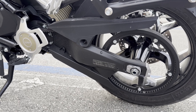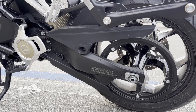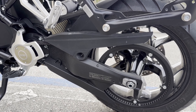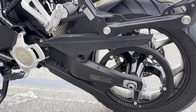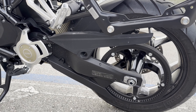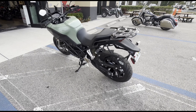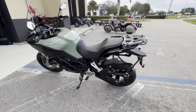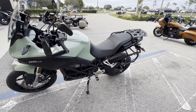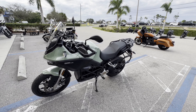My one major issue with this bike is the belt drive. Belt drives are bad enough on a low-horsepower Harley, let alone a high-horsepower, high-torque electric motor — especially for a bike built to go off-road. This is rated for moderate light ADV, but there is a chain drive and sprocket conversion for this bike which would make it much more suitable for the style of riding I like doing.